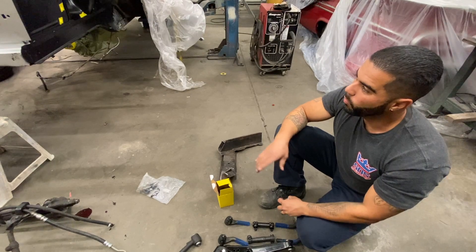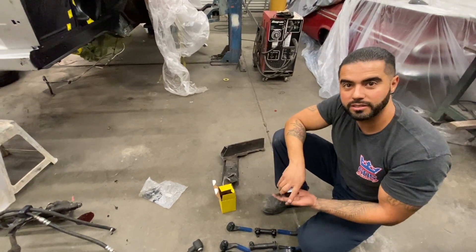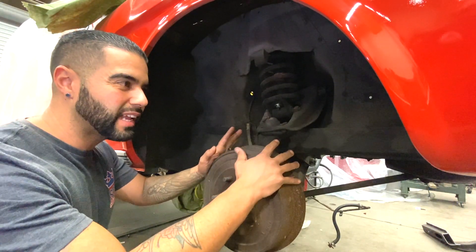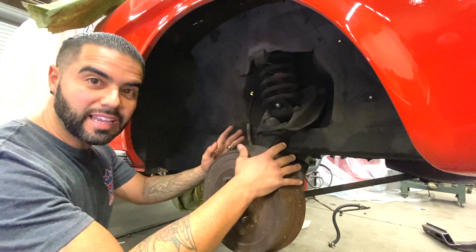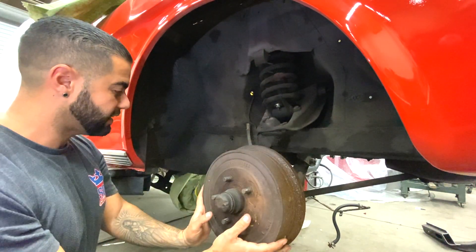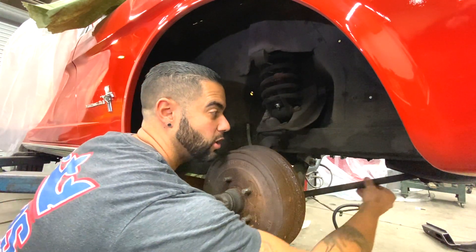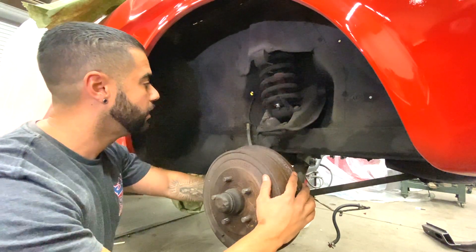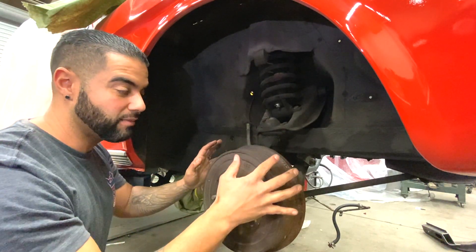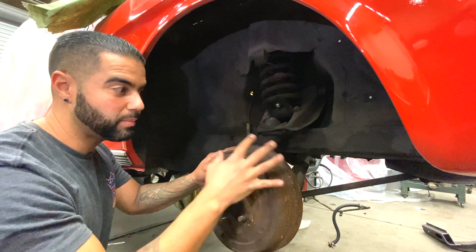When it gets aligned, we'll probably lift up the car so you guys can see the old side and compare it to the new side as we're installing. We're on the right side of the vehicle where the suspension didn't really get damaged, so you can see everything assembled: the spring, the shock, the upper control arm, the spindle, the drum brake system. That's the tension rod I was talking about that bolts onto the lower control arm and goes all the way across. In the next video we're going to be converting this to a disc brake setup, so all this old drum technology is going to be gone.